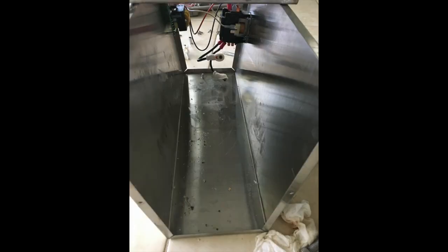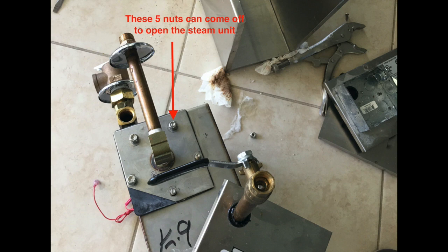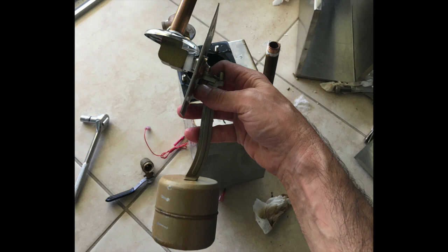This is after I took the steam unit out — this is the wet base of the unit. We take the five nuts off to get inside, and there's a plunger much like the one in your toilet that allows water to flow in, and when the water level goes up to a certain level it stops the water flow to the unit. There's also a white switch in the back called the float switch — when the water level gets to a certain level it floats and makes contact. There were some lime deposits, so I used a vinegar wash, then lime away, then baking soda to make sure it's not acidic.